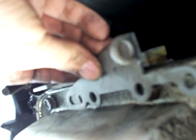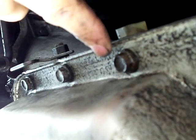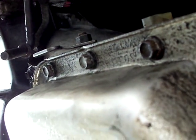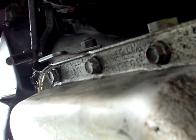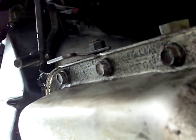And then you're supposed to take two bolts out of the oil pan, which will be these two bolts, and then this will go in place like so, using two spacers that they give so that it clears the lip. I'm going to do that next, and then we'll have both brackets mounted, and we'll have to figure out what we're going to do with the cable after that.